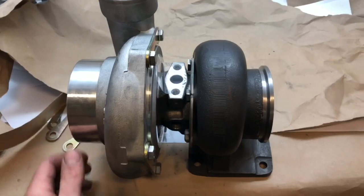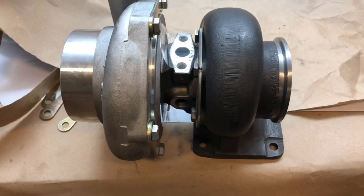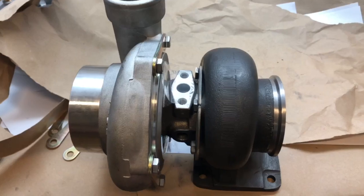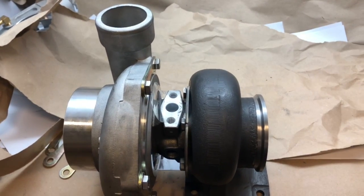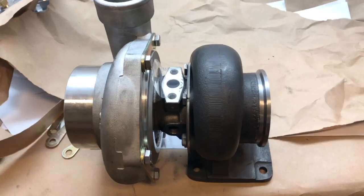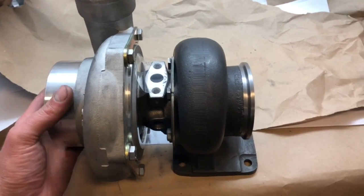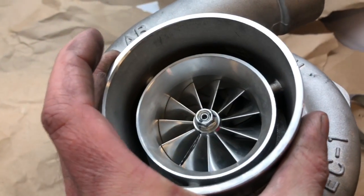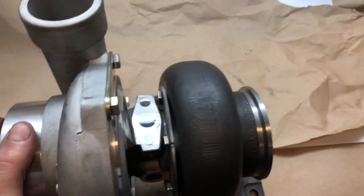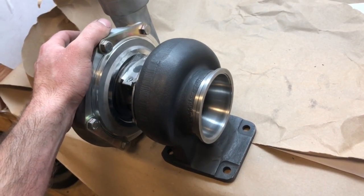The fitment is really tight on a turbo like this, especially with the GT35R series, and even tighter when you go to do it with a custom T4 housing. It's really important for me to make this right — the tolerances are really specific, so it is a challenging job, but if it works and everything goes well then it's totally worth it. If you want to see more about the E36, subscribe to this channel because I'm planning on putting this on the E36 within the next month or two, whenever spring starts to come and it stops raining.